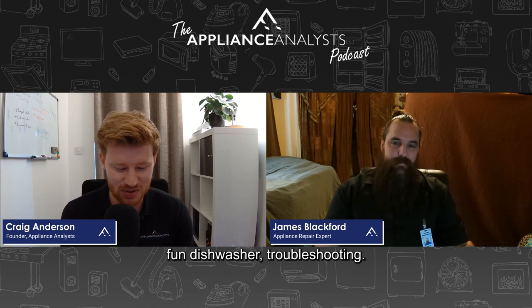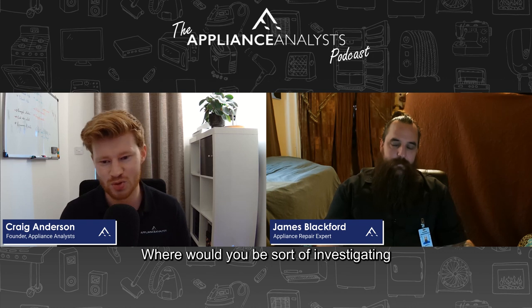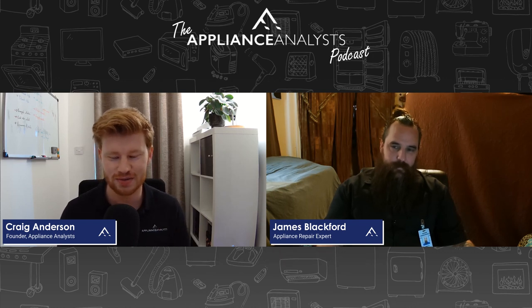Sounds good. Just continuing on with the dishwasher troubleshooting, trying to help anyone out there who's got any of these particular issues. Going straight down to the dishwasher won't turn on at all. No lights, no sound, anything like that. Where would you be investigating first? The very first thing to check is to make sure the garbage disposal comes on. They typically are on the same circuit.